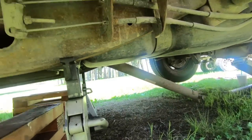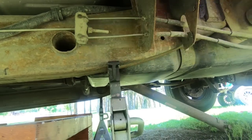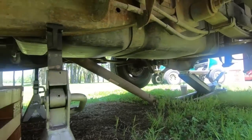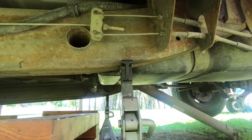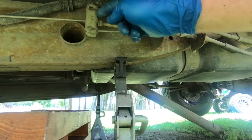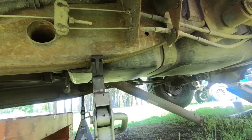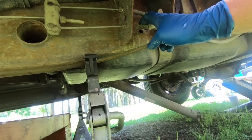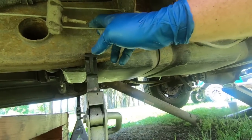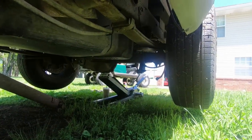So now the drive shaft is out. And I think what I'm going to do is unhook the e-brake lines right here. To me, that's the easiest spot. You can undo them on the backside of the wheel, but it's a little bit of a cumbersome job. And so I'm going to release some pressure on this line, and then we're going to go ahead and just pull these two guys out and thread this stuff back in the back. If I decide to reuse, I actually think these are the same, but if they are not, I'll take the ones off of my green truck and we'll just replace it. But anyway, I'm going to get those out of the way, and then we'll move on to probably the brake line next.